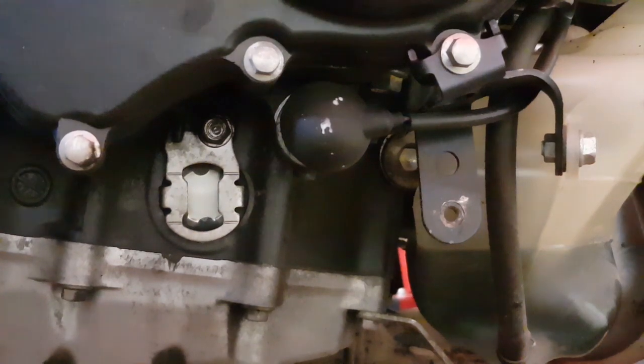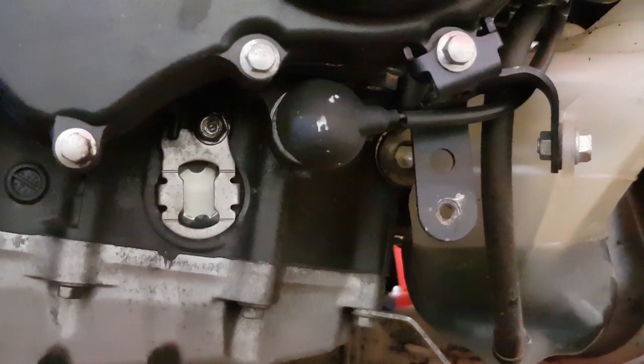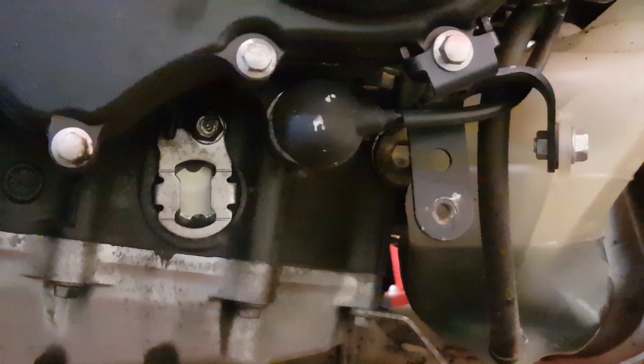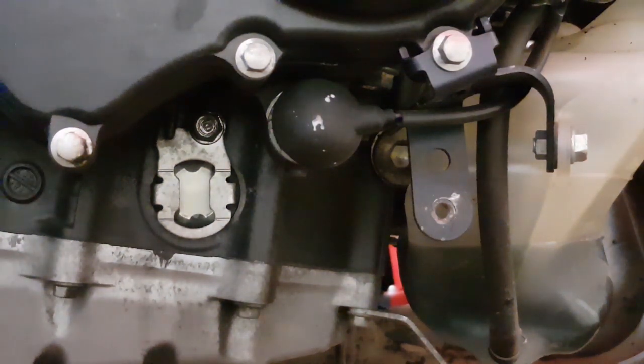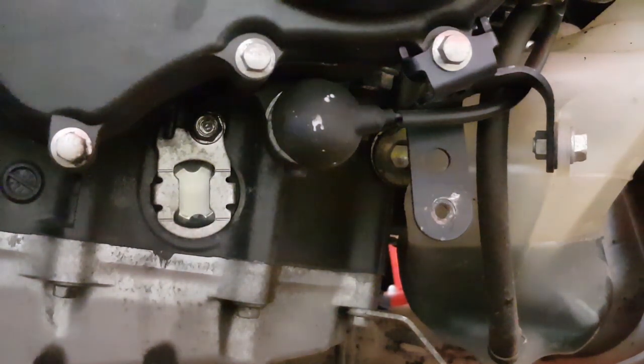The bike's had a run and as you can see it looks as though there's no oil at all — once we come off just ever so slightly, we're not going to need a lot. It's just a case of adding a little by little and being patient, as it takes a little bit of time for the oil to travel from the top of the engine down to the level gauge.